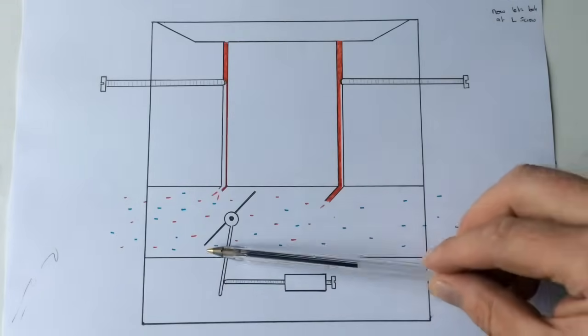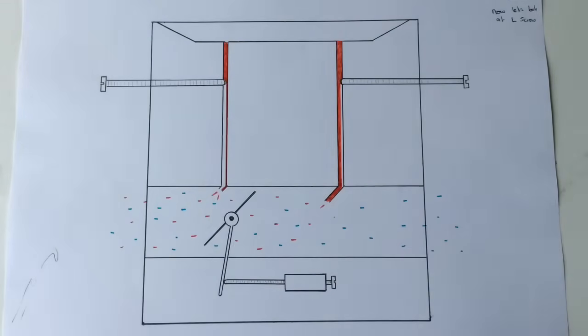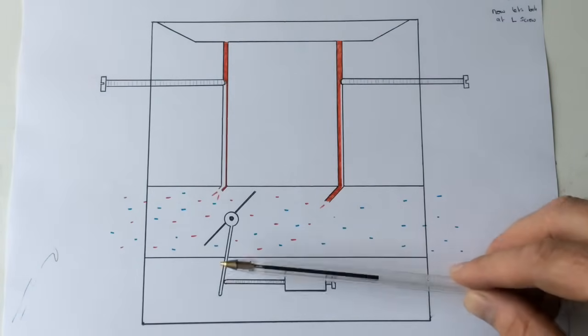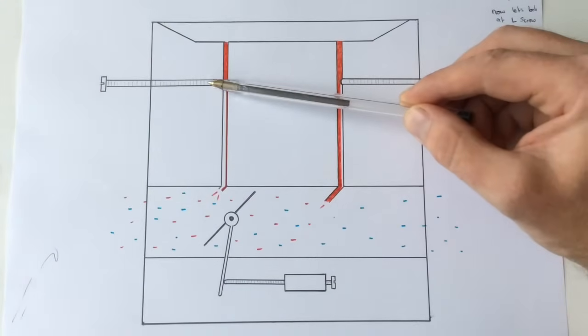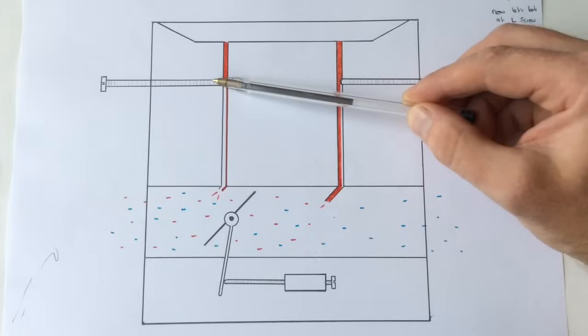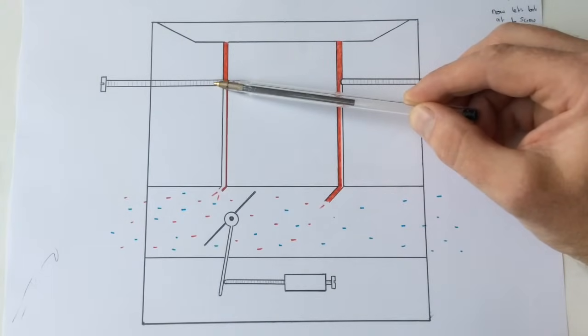This is where the low screw comes into its own. Firstly, as we adjusted earlier, the tick over is slightly off the sides there so that we can get some flow going through. We don't need to hold the throttle anymore - we're letting this screw do it for us. What I normally do then is let it idle...